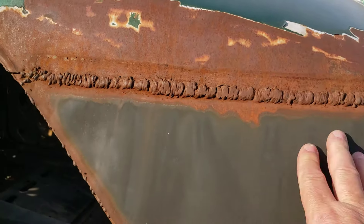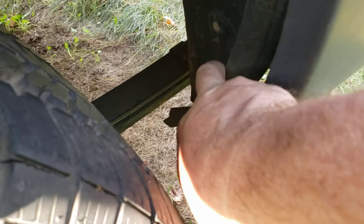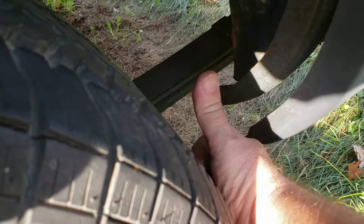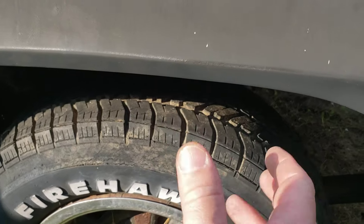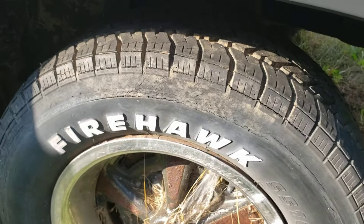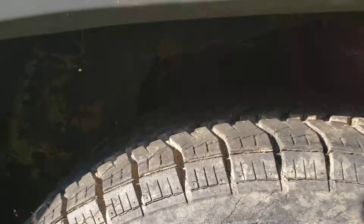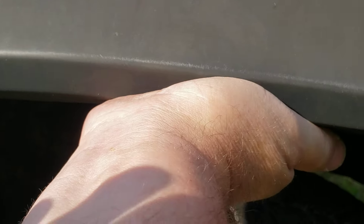So we're going to have to cut right through there and take this off, and realign it. They fixed the inner wheelhouse but as you can see it comes way down past where it should go — that should go up. The whole thing has slightly spun. Instead of changing the whole wheelhouse, I've got an inch — I can put my hand in between the two panels. That'll never close together.